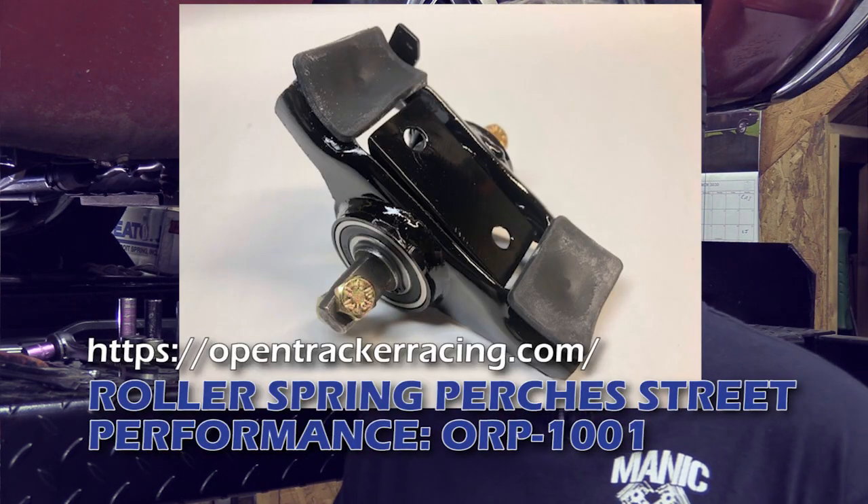I'm going to give you some things that will make a difference with your stock suspension. The first is roller spring perches. I poo-pooed roller spring perches for a long time — I thought the spring perch is just holding the spring, how big of a difference can it make? But I'm telling you right now, the roller spring perch on this Fairlane made a real difference in the ride quality and handling. Ford originally designed the SLA suspension on the Falcon to run a roller spring perch, but didn't go with it because it was too expensive, so they stayed with the rubber-isolated spring perch — and voilà, you have a car that doesn't handle quite as well.